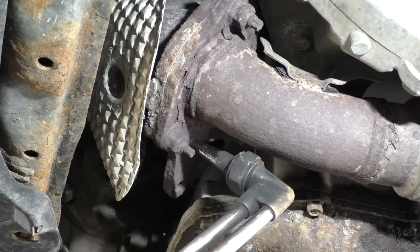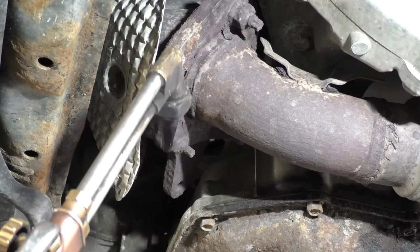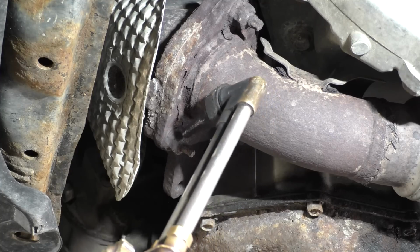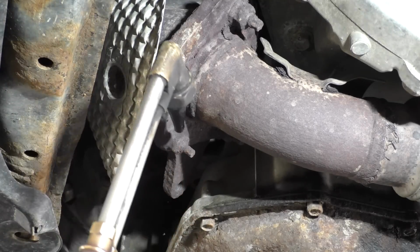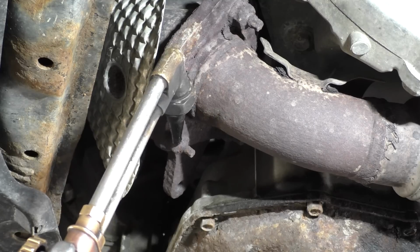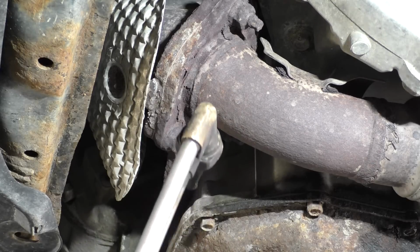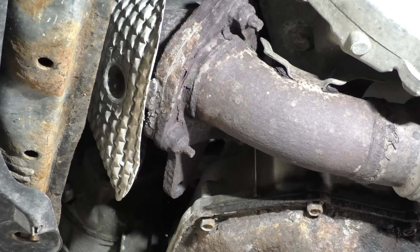So like I say, this nut's not too bad. This one here we could probably heat up, just pop a socket on her, and Robert's your mother's brother. But what we'll do is we'll take the torch, and you've got about one chance to do this, because what you're trying to do is heat up the nut, and then we're going to blast her with some oxygen. We'll oxidize it, and essentially blow it away, you know what I mean? And so we'll come across it, we'll get the nut just about blood red, and then one time, just you don't get it on the first time, you need to stop, because the heat's going to transfer to the stud at that point. But if the stars align and everything's right, you'll just nick the nut off, and you'll barely touch the threads, if at all.